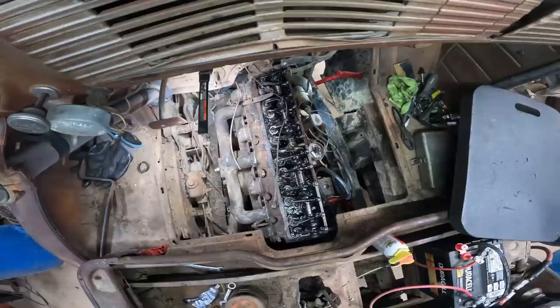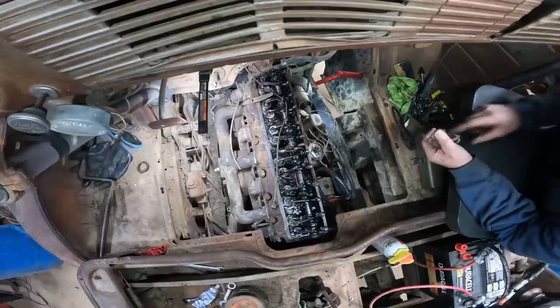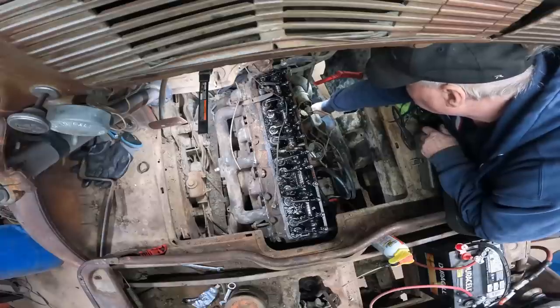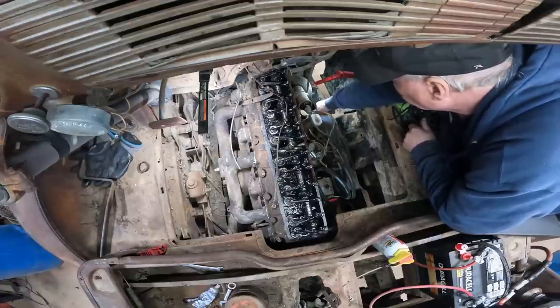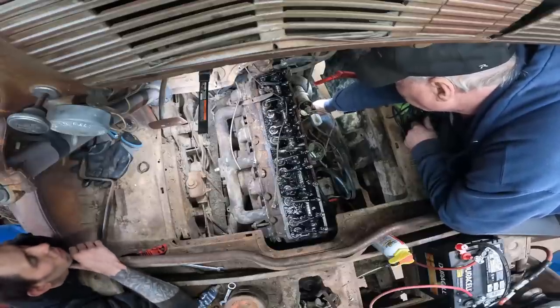Most of the lines don't like the new fuel with the alcohol in it, or as they say, ethanol. I got an extra long piece here, but probably going to need it for the can. Okay. Another thing, when you order this from Pep Boys, you tell them you don't want the high pressure fuel line. Yeah. Because that's what they'll send. And it's about $3 a foot.